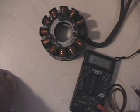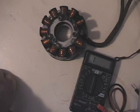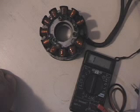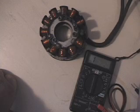It doesn't mean 100% that the stator is okay. I've had a couple of stators sent to me that ohmed out well and ohmed out good, but they were bad. I would send another stator out, they'd put it in, and their sled ran good. So there's always that possibility that your stator could ohm out okay but yet not put out the needed voltage to run the ignition on your sled.